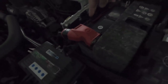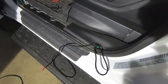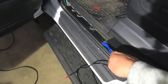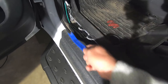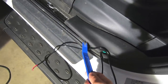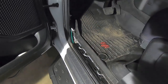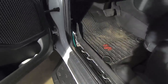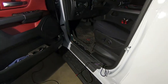I'll run the wire up through the driver's door sill, then pop through the firewall using the rubber grommet there — same one I used for my stereo power wire. I'll open up the A-pillar trim channel with a panel tool, prying up the carpet tabs so I can lay my wire in there and close it back up. Then I'll make my final connection to the home-run wires going up to the Trigger in the engine compartment. The wire from the rear sill runs all the way forward and pops through the firewall.